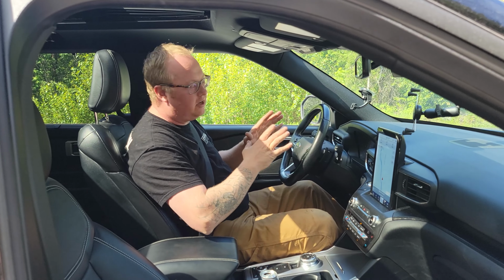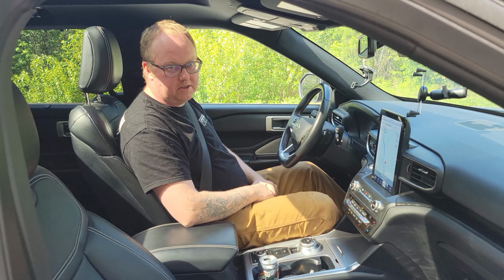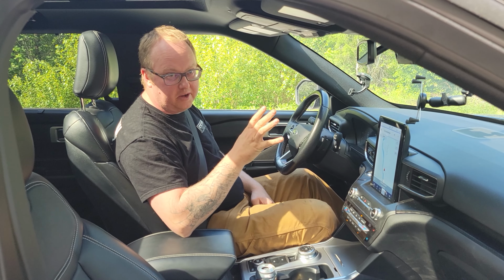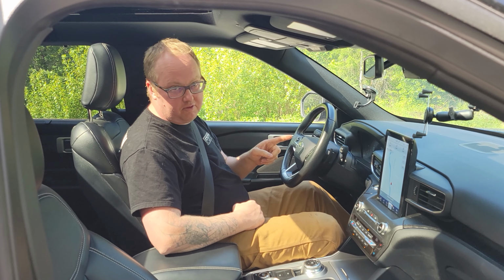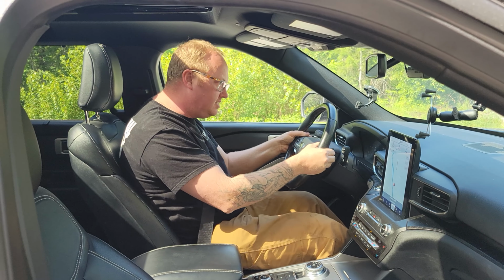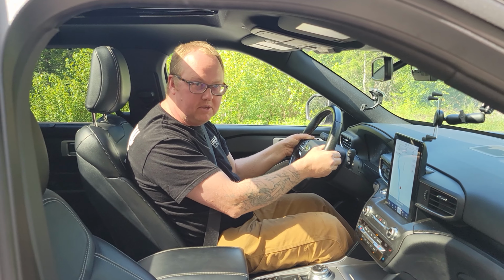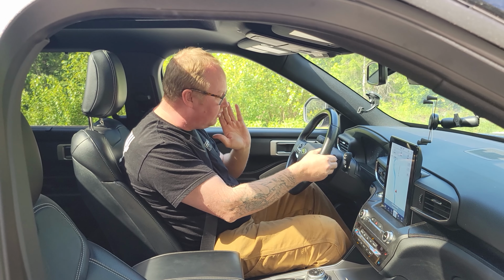Okay, we're going to delve into the ZFG trans brake launch control. Step one, get it into the desired mode that you've spoken about with Adam and turn off traction control. Step two, put that brake into the floor, as far in as you can, right like this. Both hands, pull back, stab the throttle. Just want it to at least 2000 RPM.